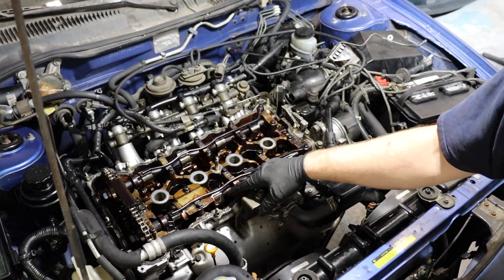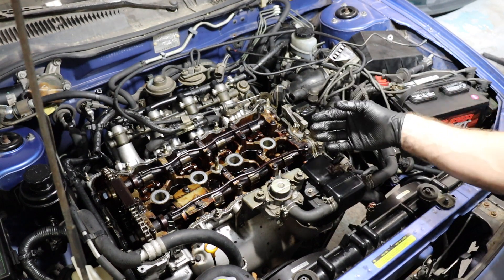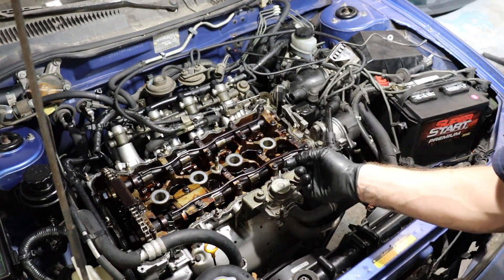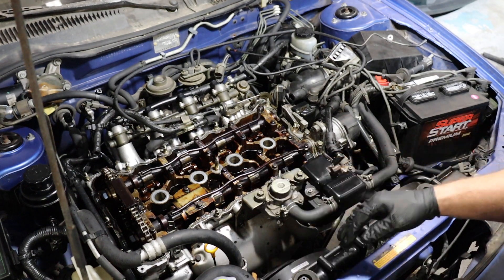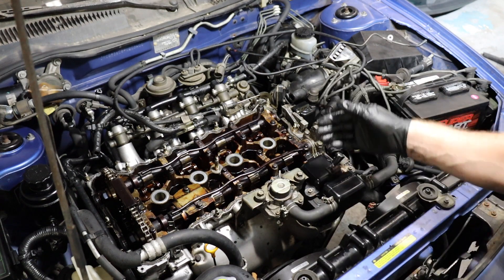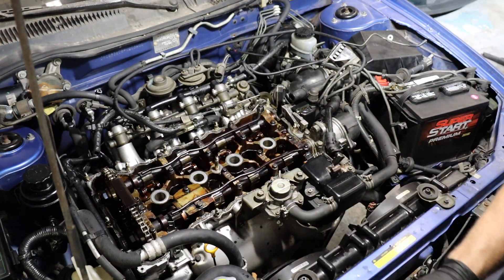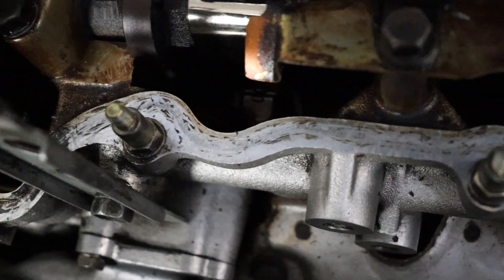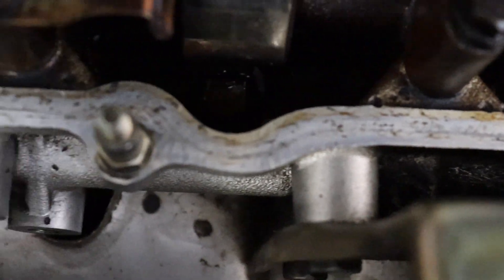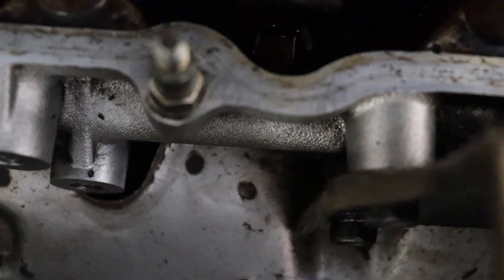If you do experience an over-application of RTV when you're doing a valve cover, don't use something too sharp. You can use a razor blade if you're very careful. I like to use a plastic razor blade so I don't nick the sealing surface, and make sure none of this RTV falls inside the valve train. You want to keep that clean in there. Try to get all that up — you want a clean mating surface when you go to put that new valve cover gasket in. It sure takes a while, but you want to get it down to the metal, nice and smooth, ready to receive that new valve cover gasket.